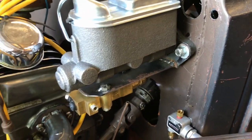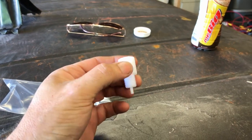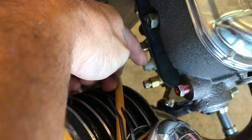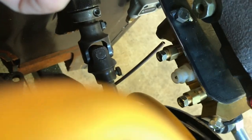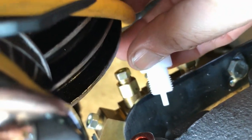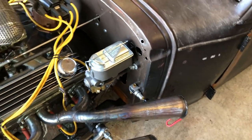Time to plumb in the rest of the brakes. Today I was down at my little brake store and I picked up this combination valve bleeding tool — this is required to bleed brakes with a combination valve. If you look at this side of the combination valve, you see this little brake fault sensor. It detects if you've got a leak — there's a piston inside the valve, and if it detects low pressure it closes off. But if you're trying to bleed your brakes, you take out the sensor, put this tool in, and that little end stops the piston from moving. So you can bleed your system, and once it's all bled, take that out, put the sensor back in, and we're good to go.